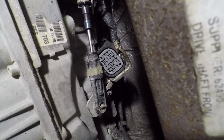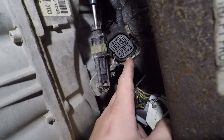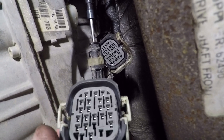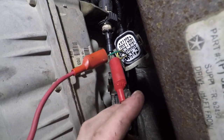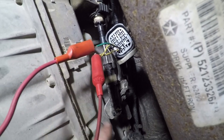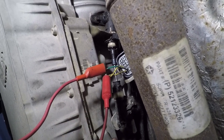Well, it turns out my plan that I thought I had thought out so well is not the case. I didn't even think about the fact that what I cut was off the wire harness — that's what I took off the truck. So let me take a minute to re-evaluate. After a few minutes, here's what I came up with: I stuck two wires in there for pin four and eight and they're together on one alligator clip, which is not currently connected to anything. On the other alligator clip I have pin five, and that I have grounded to the ground up here. So now when I put the key in, it should read reverse, and then when I take this alligator clip and ground it out, we should see neutral.